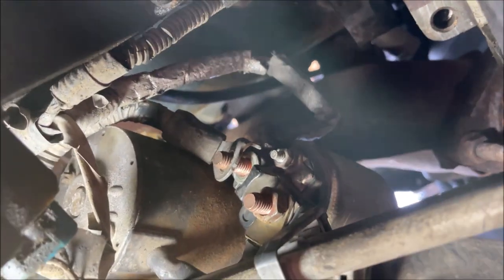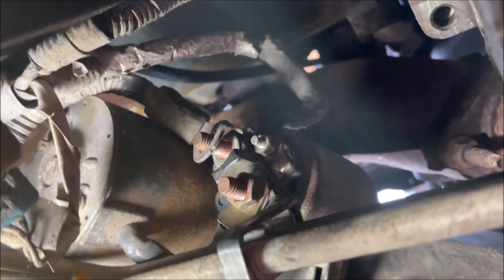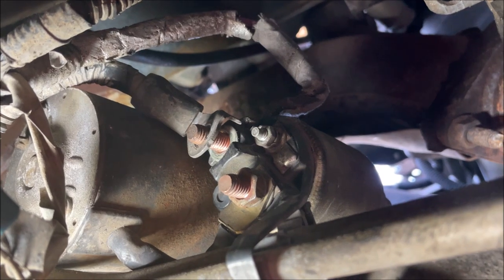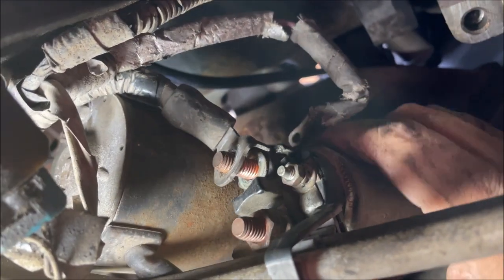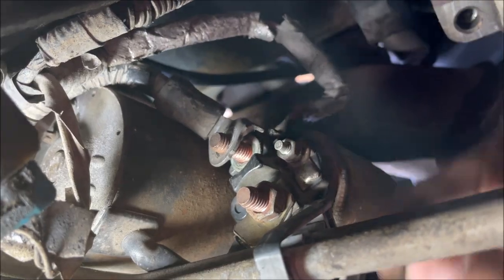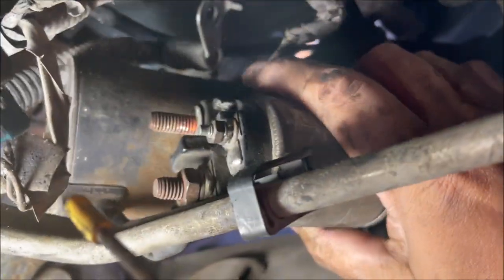Do not confuse your starter wire with the fuse link wire going to the fuse box. Go ahead and take a screenshot. Notice it has this little tang that fits in a certain way, and notice how it's over here by the S-wire — remember that. Then get the new one on and work in reverse.